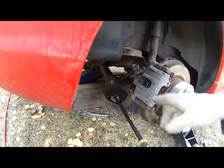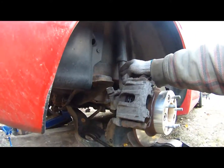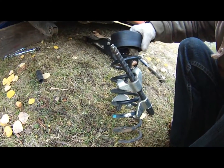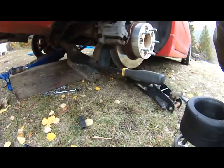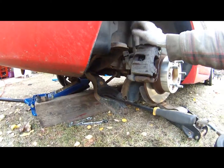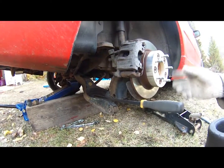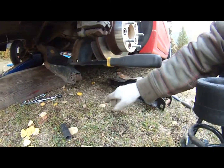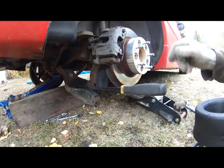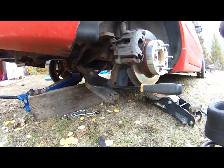The sway bar and links had to be undone. There's one bolt going through here — the shock can be left in place because this is a separate piece. Use the spring compressors to get that all squeezed down. It's pretty hard to get them on when they're in there, but you have to. Then put it back in, bolt it back up, use the floor jack to lift it into place, slide the bolt back through, take the spring compressors off, and put the sway bar end links back on.